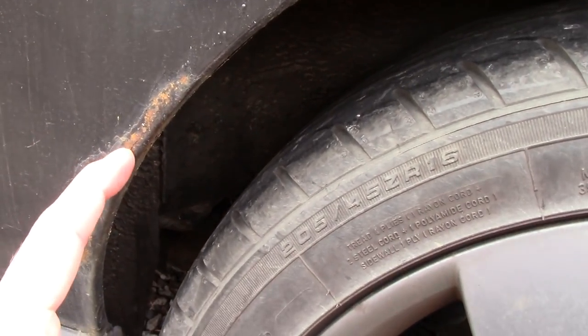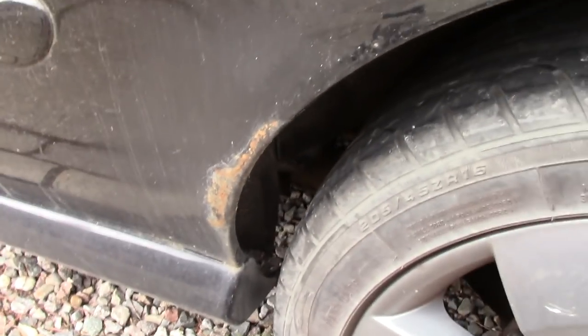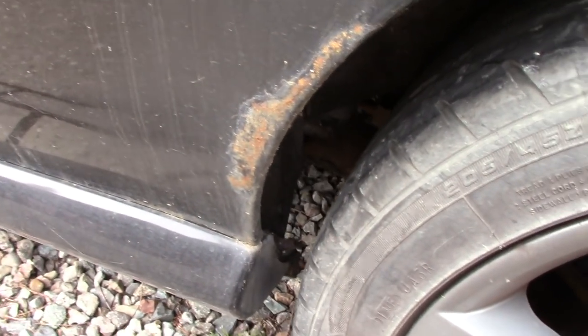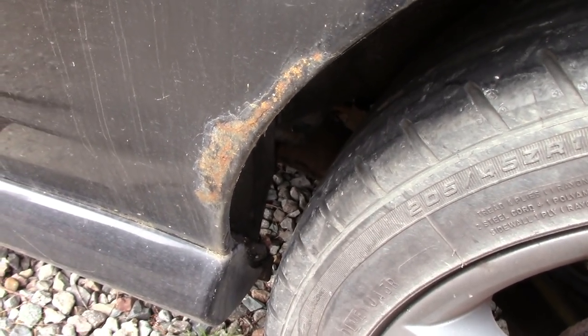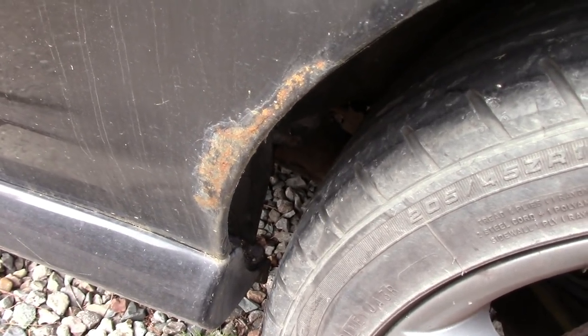It's been going on for a while and I haven't felt well enough to tackle it, so today we're gonna have a look at it. It's gonna be four phases: one — investigation; two — removal, which means cutting all the metal out, as that's the only way to really sort rust properly; three — welding some new metal in and forming it; and four — painting it.